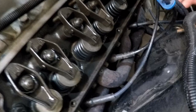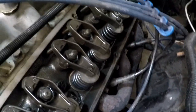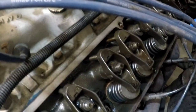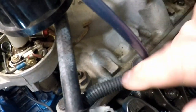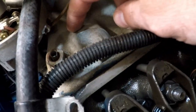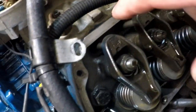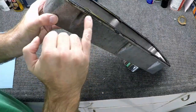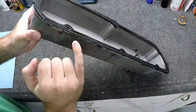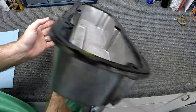It may be difficult to see, but there's a bunch of oil on the spark plug wires here. You can tell the oil has been leaking out of this valve cover gasket and it's also getting up here on the intake manifold, staining and creating a line where it's been soaking into the aluminum. Here you can see the oil leaking on the edge of the valve cover. We're going to get this cleaned up and polished, then put it back on the car with a new gasket.